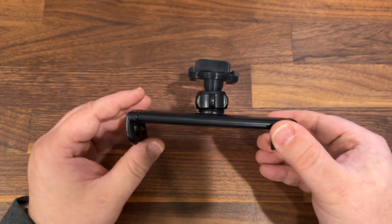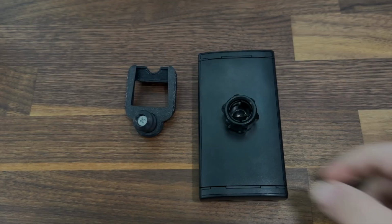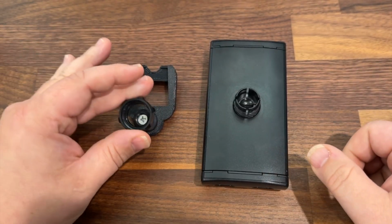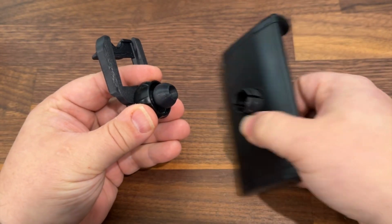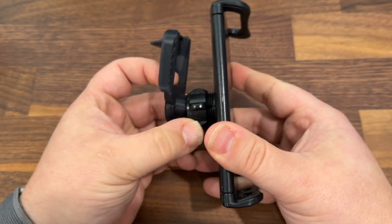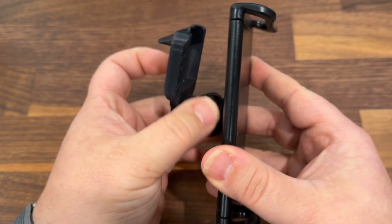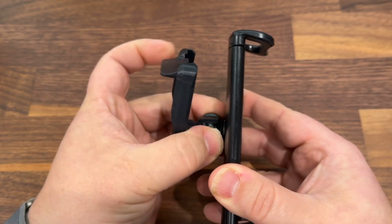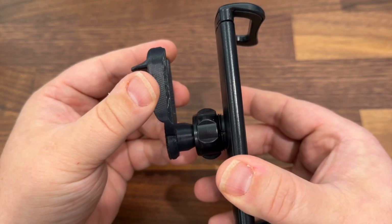We suggest installing the holder on the mount before you put it in the car. Start by undoing the friction nut on the back of the holder and placing it over the 17mm ball. Next, snap the 17mm ball onto the holder. Then slide the friction nut back onto the holder and thread righty-tighty. Be careful not to cross thread, as you won't be able to get it tight enough and it may damage the holder. Now let's go install it into your Rivian.